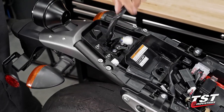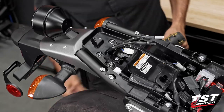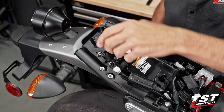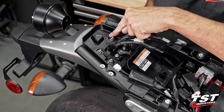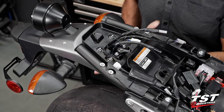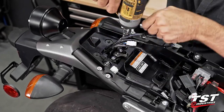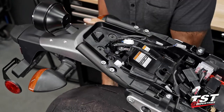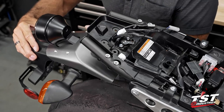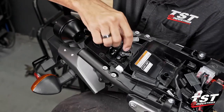Now all of our wiring is loose. I'm going to switch over to a 10-millimeter socket and remove these four nuts. I'm going to do three all the way out and then do this one last as I hold the fender so that it doesn't just drop off. Once all those fasteners are loose, this thing will just drop down — so just carefully milk out the wires through this rear hole.